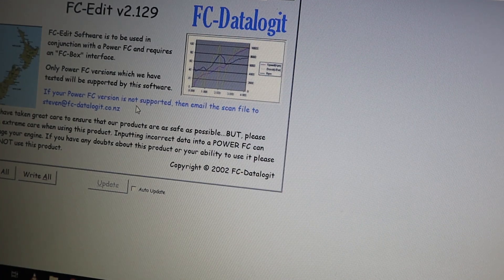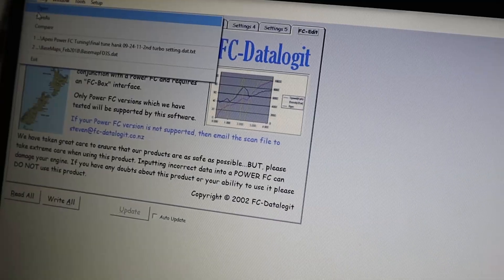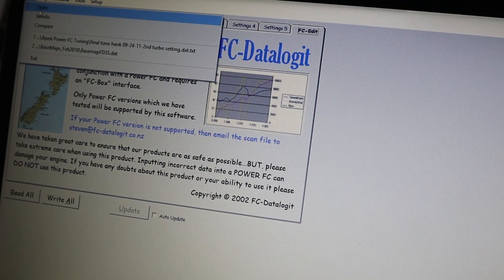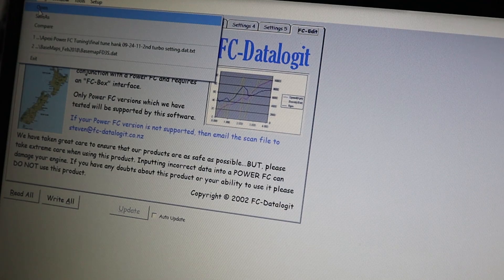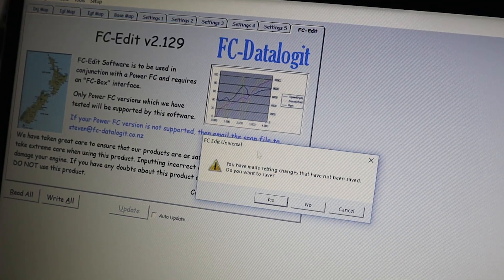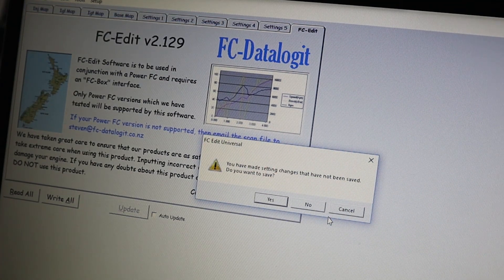What we're going to do now is load a custom map. The map I'm going to load here is for a single turbo setup — now it is not what I'm going to be running on the road, this is just for the startup. Essentially what it's doing is blocking off or stopping certain sensors from running and the car going completely haywire. It's also got a slight tune for a single turbo. Now, this is Jason's map — Jason lives in Sweden, he's got a big single RX-7 and he's been helping me out a lot with the build remotely, which has been good stuff.